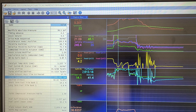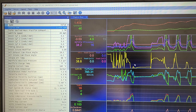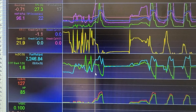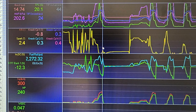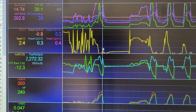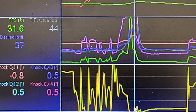Now let me show you one of my most recent logs from today. I didn't do a full run because I was getting boost spikes — I was watching the gauge and if I saw it go past 25 psi I let off. These are only small stabs of throttle but they tell me everything I need to know. I've raised my wastegate pressures and adjusted all boost-related parameters, but the biggest spike still went to about 27 psi.